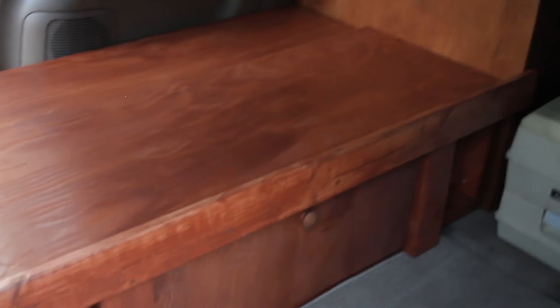So let's start with the couch and how it's generally put together. This mattress was an old mattress I got out of a teardrop travel trailer. Originally it was one solid piece, but I went ahead and cut the foam. It got a little complicated with the sewing, but essentially I just took another piece of vinyl, sewed it along the back, and it's two separate pieces of foam so it folds but stays together. For the couch and bed, I wanted it to be as simple as possible — not only to put together, but also to make, without using any expensive components.